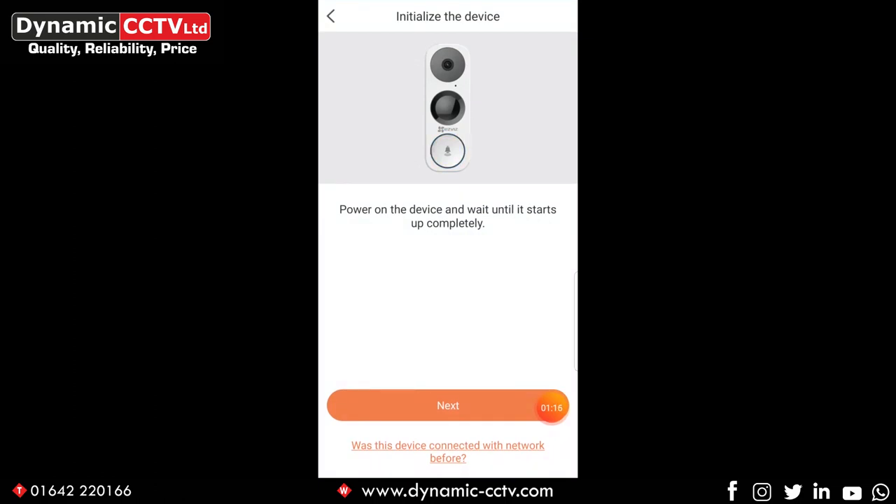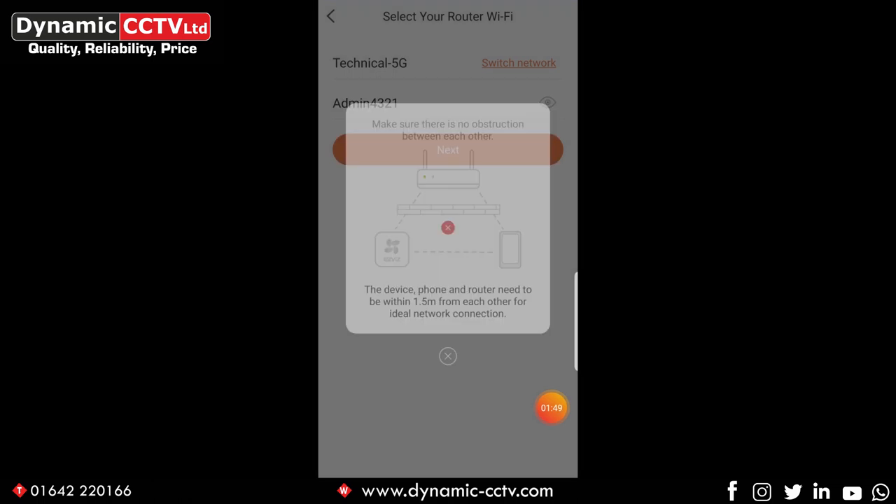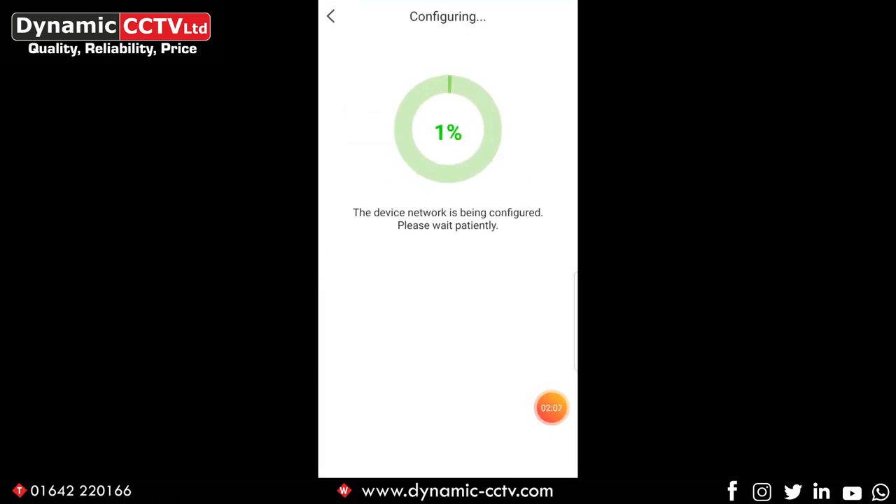It's now at the point where it's going to add the DB1 to a wi-fi access point. It'll add itself to the same access point your phone is connected to, so make sure your phone is connected to the correct SSID that the DB1 is going to run off. It will work off 2.4 and 5 gigahertz frequencies, so you don't need to worry about setting a specific frequency. Click next. It'll recommend that the DB1 and the phone are within 1.5 meters of the router. Once you've read that, click the X, confirm your SSID and password, and click next. The unit will then configure itself to your wi-fi and create a handshake with the cloud — it takes approximately 40 seconds.